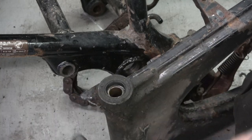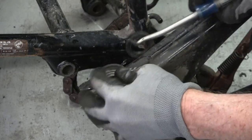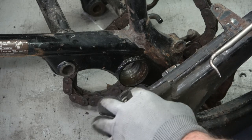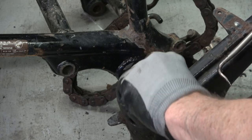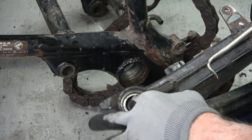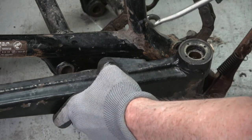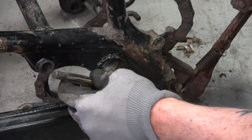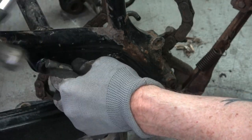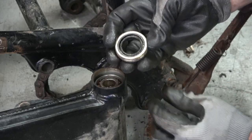This is one of the spacers or collars that go on one side, then you have an oil seal. On this side is the oil seal, and on this side — the chain side — are the needle bearings. That's the collar that goes in the needle bearing, and there's the needle bearing right there. On the brake side it's got a double-layer or stacked ball bearing setup. There's a collar here, and I don't have the correct tool to get that out, but you can just tap it lightly with a punch — it's not torqued very hard. Then you unscrew that, and there is a double layer of ball bearings stacked on one another.